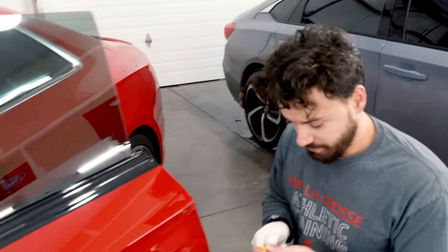Avery does not have a cap sheet on it — that's the difference from 3M, which has that little piece you peel off. Avery doesn't have it. The cutting and tucking portion is essentially the same as everything else. I like to use the non-buffered side of the squeegee and push it all the way up against the weather stripping, then push down. For the cut, exact same way as the front — pretty self-explanatory if you've already done the front part.